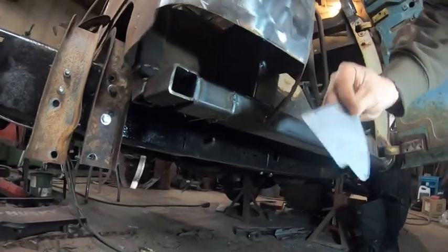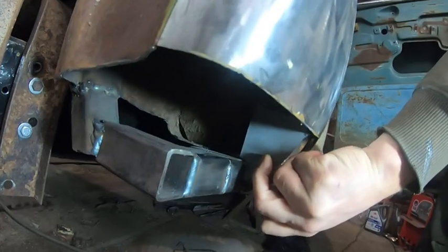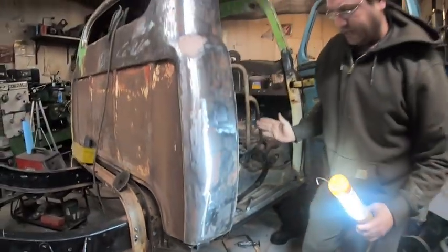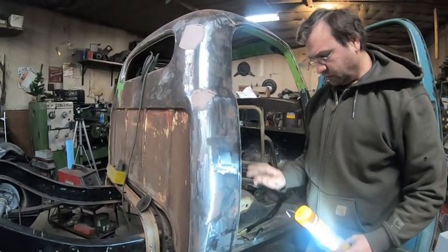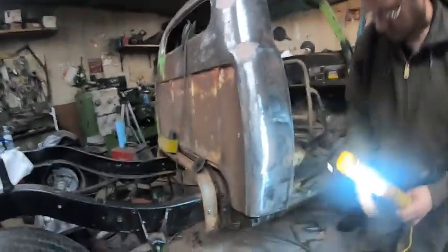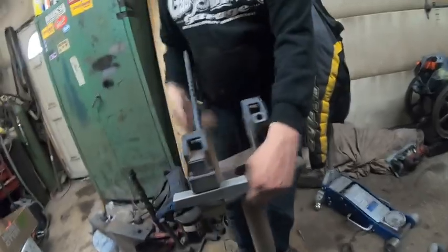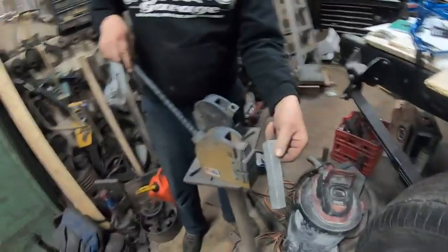We're going to make that piece and put a couple more inner structures in — this piece is going to go something like that. There's basically a box right here and we want to duplicate that, because we have to push the cab back. It sprung forward when we cut all the rust out. So Derek's going to try and make that curved little angle piece using our shrinker and stretcher — in this case just the stretcher. We basically made a little piece, bent it 90 degrees, very simple.